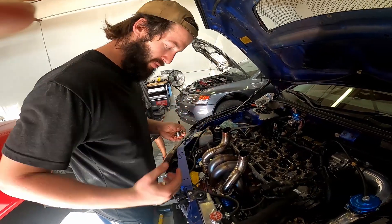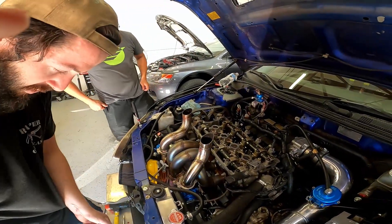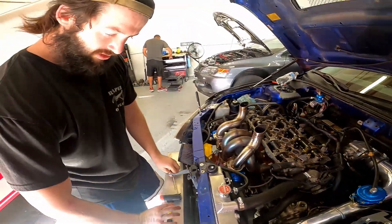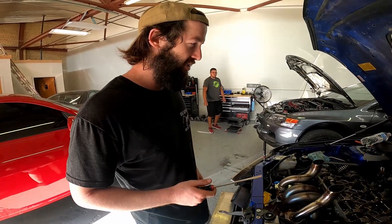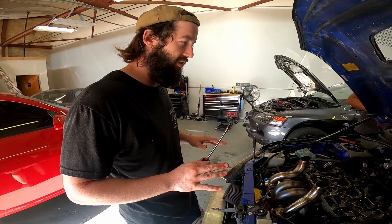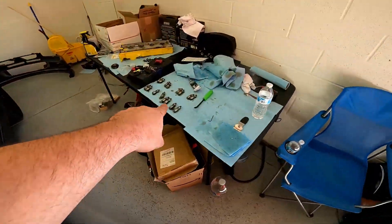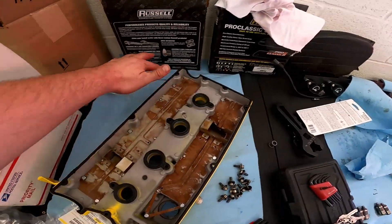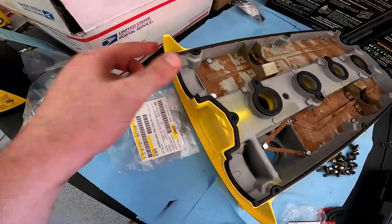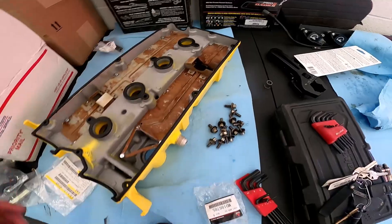When you do it this way, make sure you get plenty of bleed in there. The way we've been doing it is taking them out without the cams out. This little rocker arm is going to go in here — put the butt of my screwdriver right here, give it a little love tap, and there we go. That is how you swap out your lifters. We're going to reseal everything, put new gaskets on the valve cover, throw that with some gasket maker, make sure everything is tight. In the morning we're going to come back and do the pulleys and probably the oil pan too. All the lifters have been replaced. I threw some gasket maker underneath this gasket just to make sure it's a nice tight seal — she shouldn't be leaking from up top.